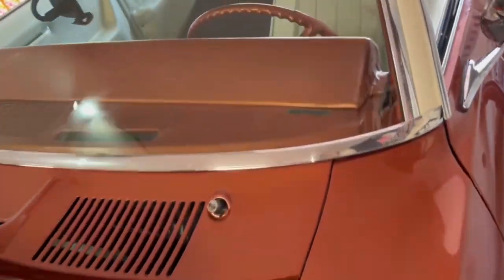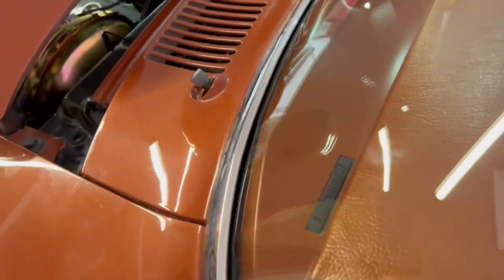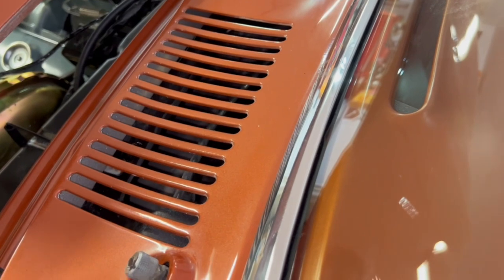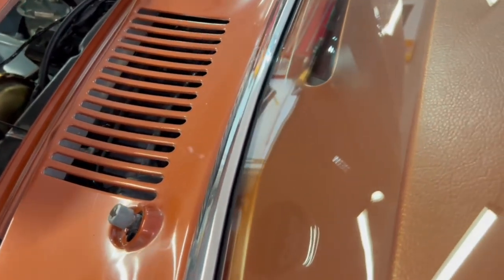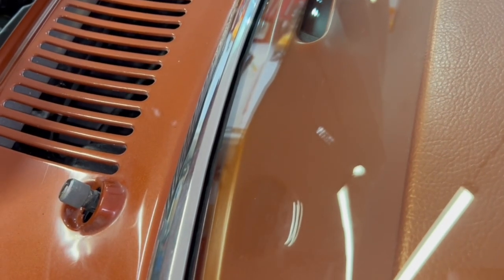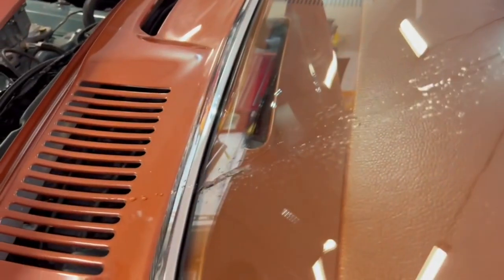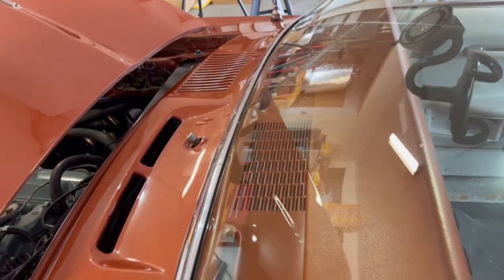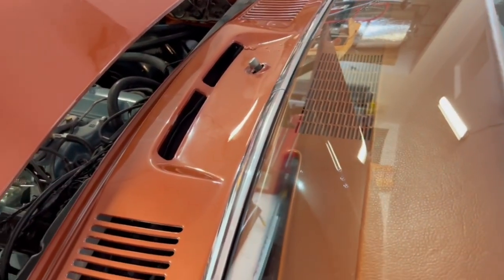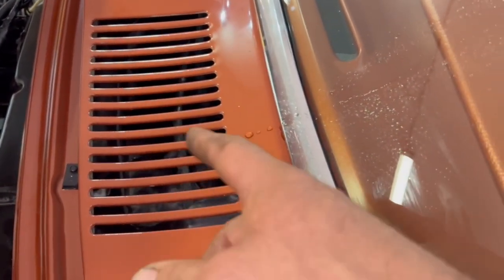Turn the key on, push the button in — it should make the washer engage and eventually something's going to come out. There's probably a better way to prime the system besides just holding the button down. Oh hey, look at that — there's one side and there's the other side! That works — I've never had one of those that actually works. Not the most beautiful spray pattern, but technically it works. It's just a small hole drilled in the end of that tube. Washer system works!